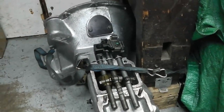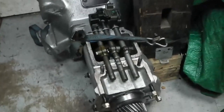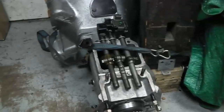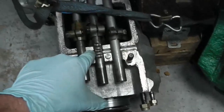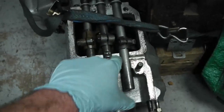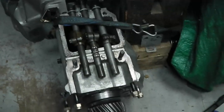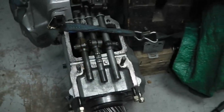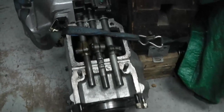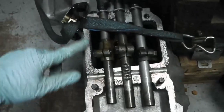I'm just having a look at the gearbox tonight. I was hoping not to have to take the top off, but with the detent plungers in there you can't actually select two gears to lock the box with the top on. There are two little items - they look like elongated ball bearings, almost very short bearing rollers - then a ball bearing either end and one that sits on the selector, with an odd spring on the reverse side. Just be very careful when you remove the top that they don't fall down into the box; they very often do.